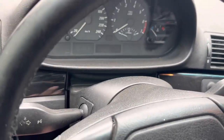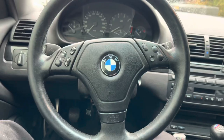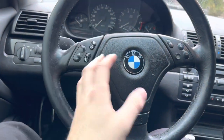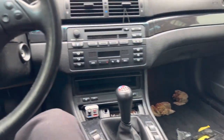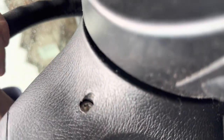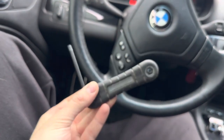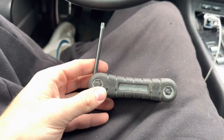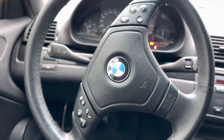So I'm trying to get this screwdriver put into right there. Alright guys, so it turns out this steering wheel is actually bolted in with T25s. I don't know if I have any of these with me — I'm at my house right now. I ended up looking back behind here and found it's actually a Torx 30. I didn't even end up going to the shop. I have this in my garage — it's a Mastercraft torx allen set — so this is our Torx 30, I'm just going to go ahead and loosen it up.